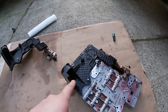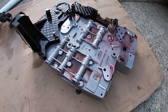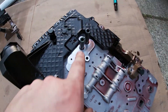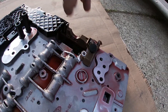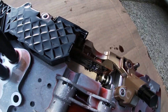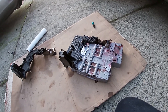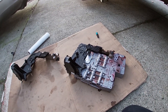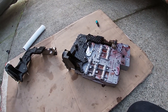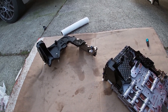Here is the old lead frame and here is the new one on the valve body. As you can see, it didn't get separated, so just those bolts — there are bolts on the other side that hold this on, so we will have to flip it back over. Looking at the sensor here, there is no ball in it that's supposed to sit in there. Whereas on this side, you can see the little protrusion. They did provide a gasket to put on the new one for these sensors — this one doesn't look like it even had one. A little bit better design just to keep any type of metal particles from causing problems. As you can see between the new one and the old one, that definitely broke off or something. Not a bad thing that we're replacing this whole thing — it replaces a lot of different sensors.